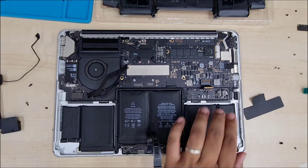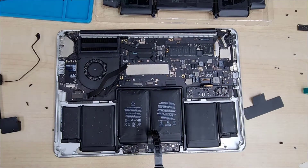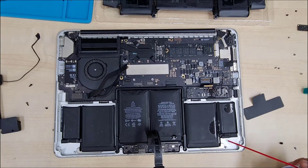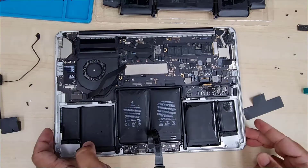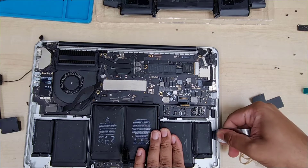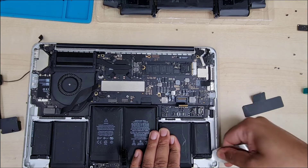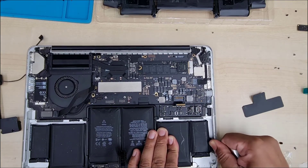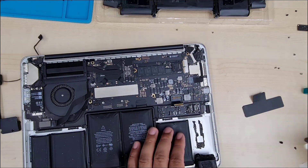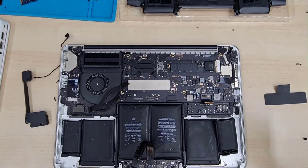Removing this large lithium-ion battery is not easy because the adhesive underneath is super hard. Using 99.99% rubbing alcohol works very well — you can use a PCB cleaner or 99.99% rubbing alcohol. Once you apply it, give it a couple of minutes, then try to spudger it. A plastic tool would be better, but I always use metal tools to make it quicker. I never suggest using metal — plastic is better. For the video I've shortened and cut a lot of the footage, so please take your time.